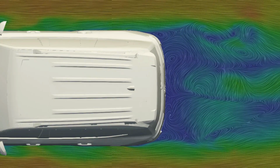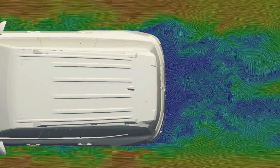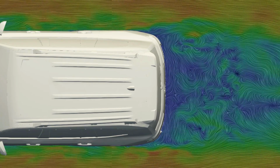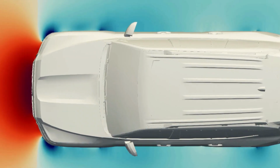I'm quite surprised how the rear edges of the Cruiser are rounded, but the flow refuses to stay attached over them still. As a result, the wake is massive, very much like a brick, so that rounding seems to be unimportant here. The good news is that the pressure in the wake here isn't really that low, so if you could reduce the super high pressure at the front, the drag would drop nicely.